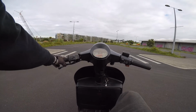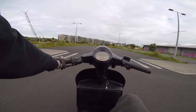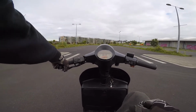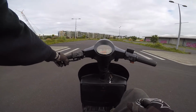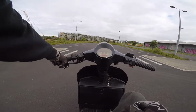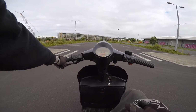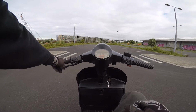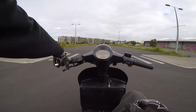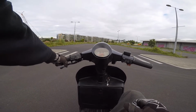Now the difference from power wheelies to balance point: power wheelies, you're rolling along and you clutch up and you use the gas and you're just pretty much going until you're running out of RPM, which you can go a long way, and it's alright for beginners, but you do have a lot of speed and things can go wrong. So I'll show you that, and then I'll show you how to do balance point wheelies, which are a lot slower and more controllable once you have control of the rear foot brake.